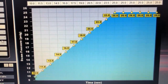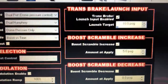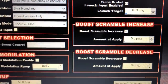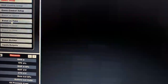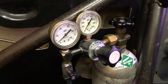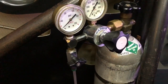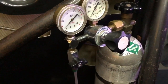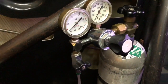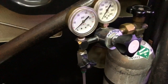At the end of the pass, I'll turn the quarter-turn valve off — that's the way I conserve, but it does potentially use a little bit more CO2. Anytime you hit the trans brake it will go to my launch enable, so it leaves with 10 PSI, and then I've got 5 PSI on the scramble button. I used to just turn it on when I got into staging lanes, but what I found is during burnouts it was hard to control the boost — it would run away and make 10 pounds of boost in the burnout box. So I started turning that valve off, which has bitten me a couple of times where I forgot to turn it back on and then it doesn't have any CO2 going down track. That's the problem with doing it that way, but that's what the quarter-turn valve is for.